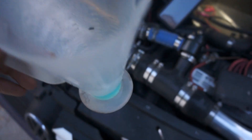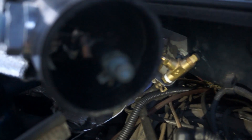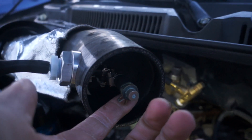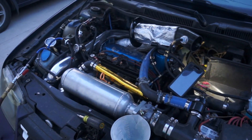That's kind of what I was aiming for. In a minute that much fluid is going into the system, and we're doing pulls for 10 to 15 seconds — so a tiny, tiny amount, just enough to cool the charge air going into the car. Although the system is a little bit ghetto and janky, it does seem to be working. About 25 cc's per minute, nozzle works just fine. I got it off Amazon and I'll put a link in the description. Everything is glued and hose-clamped inside so it ain't coming off, and it seems to be safe.